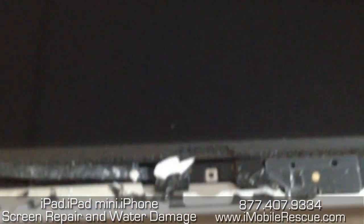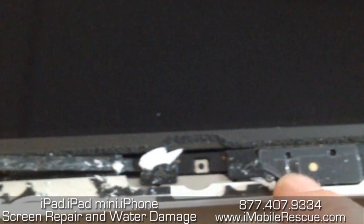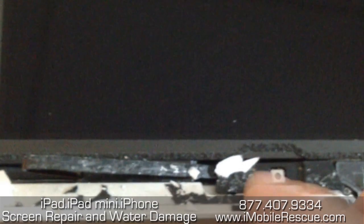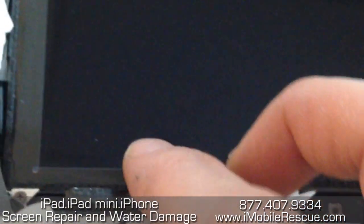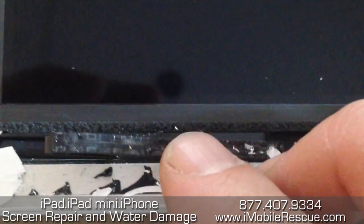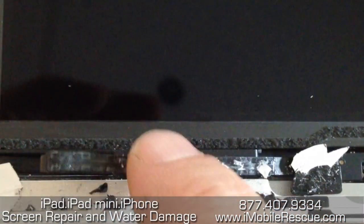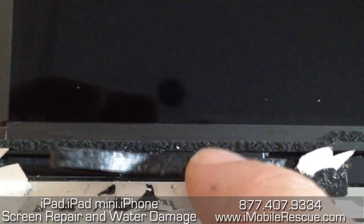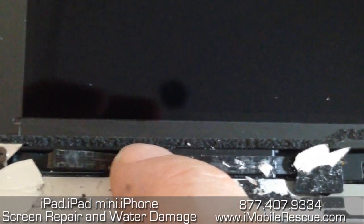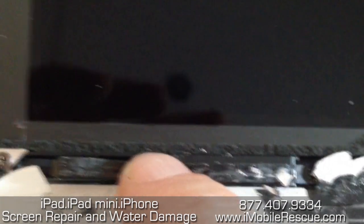So that's where it is in relation to the rest of the iPad. Here's the iPad — this is the Wi-Fi antenna, here's your home area, and this flex cable goes down into that spot. You just want to be incredibly careful taking the glass off around that area, because look — it sticks. This would have stuck to the digitizer. I just had to heat it very, very carefully knowing where it was and peel around it extremely carefully.